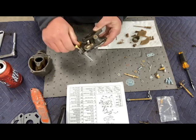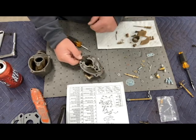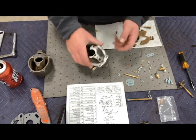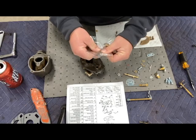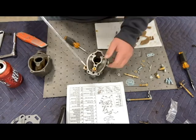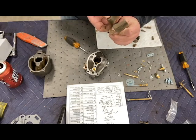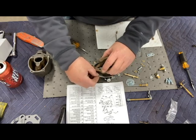With the spring, washer, and gasket on, this will fit down in there and stick out the bottom — be careful not to bend it. We're done with the top side. Now we'll flip it over. The needle seat and gasket assembly needs this out of the way first, so I'll unscrew it. The needle seat and gasket assembly comes in a separate package. I'll get a larger screwdriver to seat it properly.